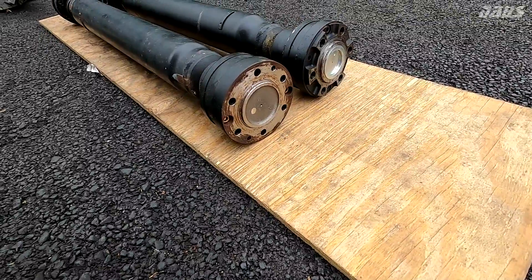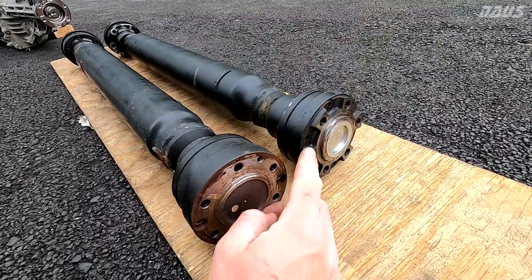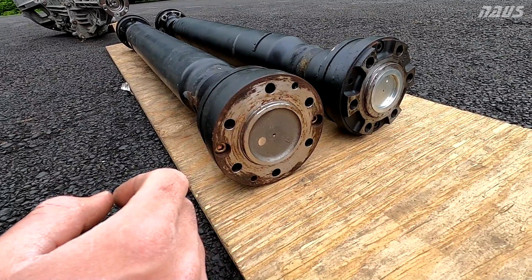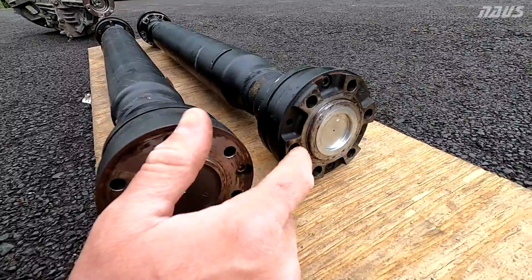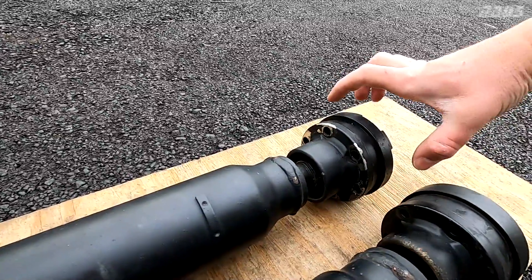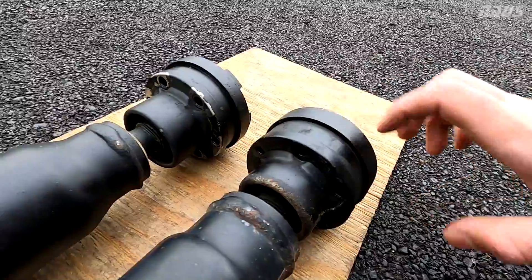This is a look towards the diff. There's a much different pattern cut out on the AP-2, while the AP-1 is all flat here. Another big difference is the through holes — the AP-1 is for an M8 bolt, while the AP-2 is for an M10 thread. So these through holes are significantly larger on the AP-2 shaft, which in turn makes that diameter slightly larger than the AP-1 below.